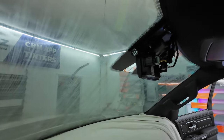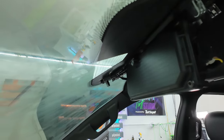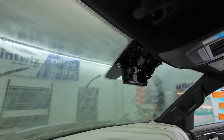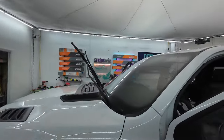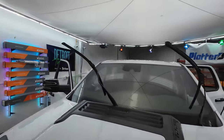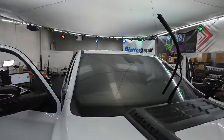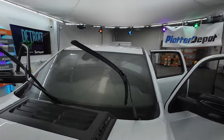The part where I would be concerned: don't do anything that's going to involve ruining or removing this sensor. That's going to be a very expensive part to recalibrate as is. If you had to replace the windshield, that comes along with a calibration as well. I don't know exactly what retail is on this particular one, but typically recals go for about 350 bucks. That's not something you can just throw a computer on and do yourself.